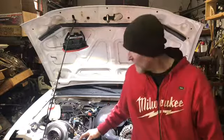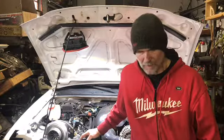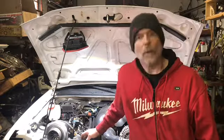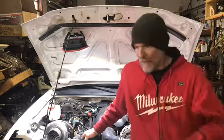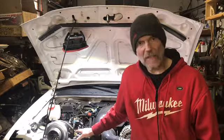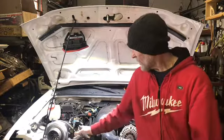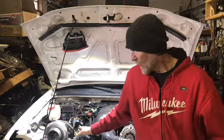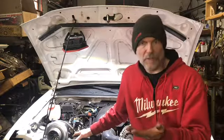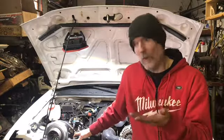It's been a while since I did a video — I've just been driving this thing and testing its reliability, and turning it up as well. I have turned it all the way up to kill. Things that I didn't consider when I was building the hot side: I sprung it really light with a four pound spring, but the way it works is that the wastegate doesn't just work off of turbo reference pressure — exhaust back pressure will also open the wastegate.